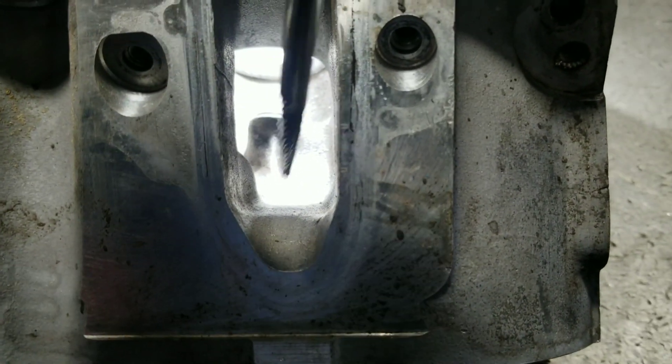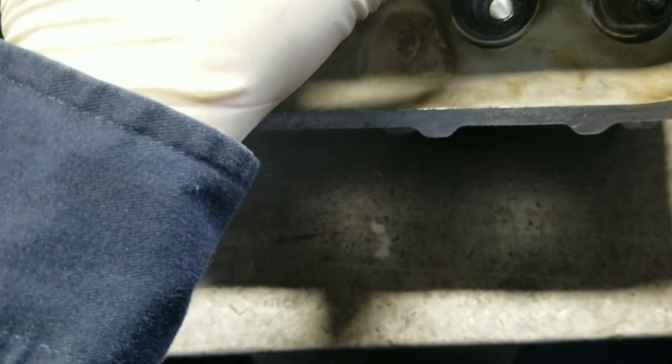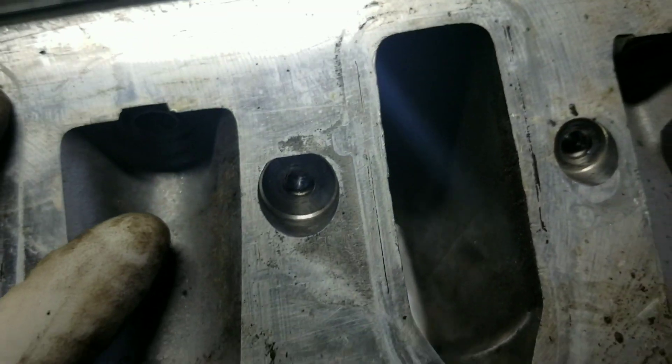You see this bump in here? All this bump in here. The main goal — if you want to do some good job, not extreme — you're going to have to take this down. You guys are going to see a hole, you're going to make a hole. Don't trip, don't panic. That hole is normal, everybody does that. That's one of the rockers. You see this hole goes all the way through the bump. So all you have to do whenever you put the rockers is put some Loctite on the thread on the bolt so it won't leak. That's one of the first tips.